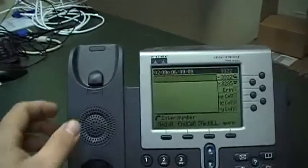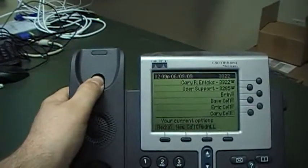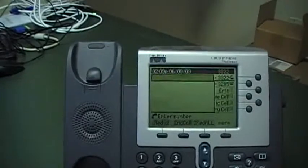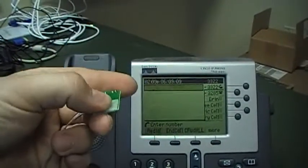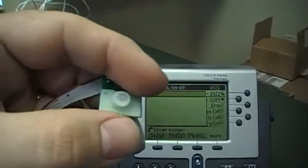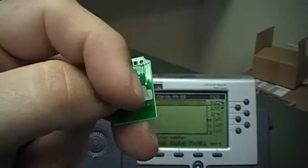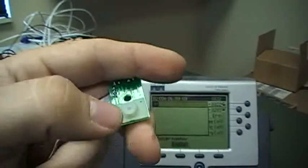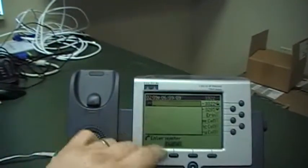The problem exists right here in this switch. Right behind here is a little plunger, which I want to show you how to get to. Basically, if this plunger isn't depressed fully all the way — right there where that little black plunger pushes into those metal leads to complete the circuit — then the line doesn't open up. So if this isn't pushing in all the way, you don't get an open line.